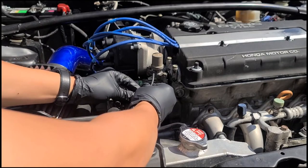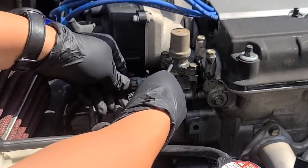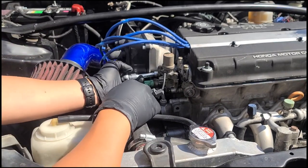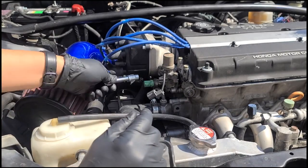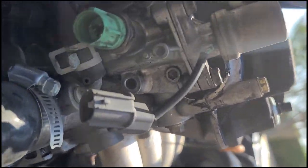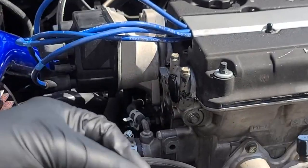The first thing I'm going to do is remove the plug on the top of the VTEC solenoid, and then remove the other plug attached to the lower portion of the solenoid. Using 10 mm sockets, I'm going to remove the three bolts on the bottom end of this solenoid. The top bolt we remove after we remove the whole unit. Take your time removing this unit — I still have the bolt on the left and I don't want it to fall somewhere unreachable.